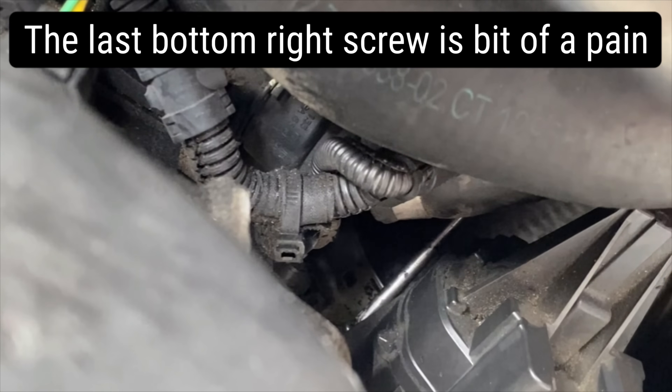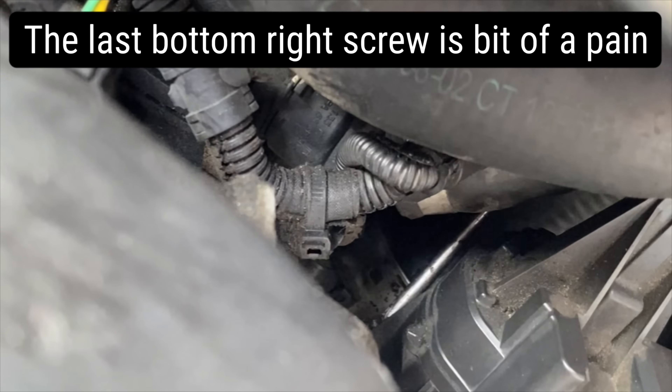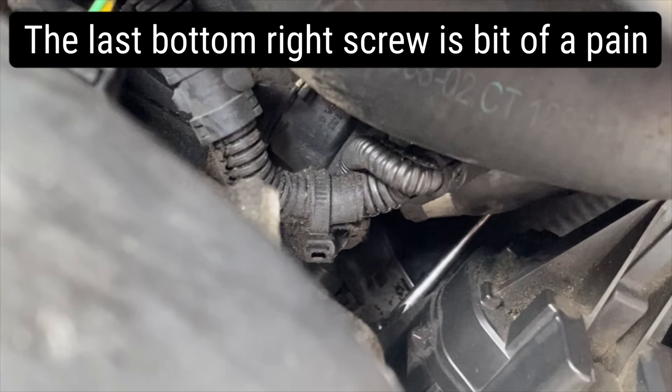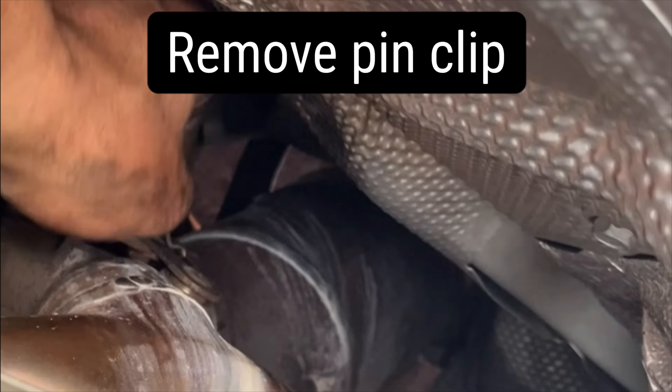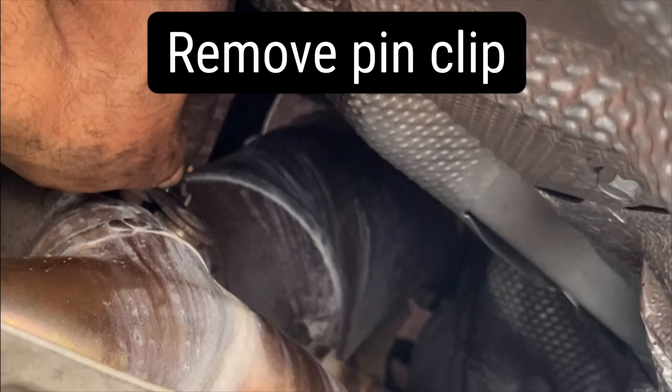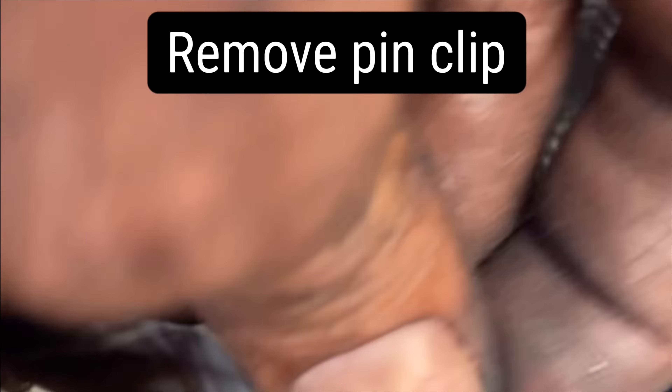It uses a flat — actually use a Phillips regular screwdriver. I didn't take my manifold off, but I still got the screw out without dropping it. Alright, take out your clip — you just kind of jiggle it up, rotate it and push it out. That's your clip.